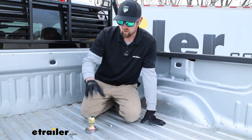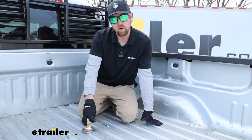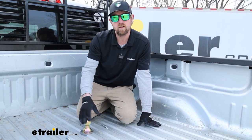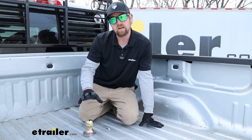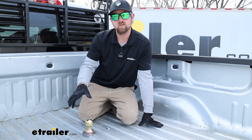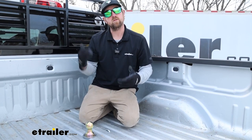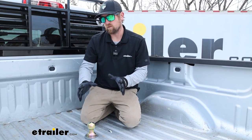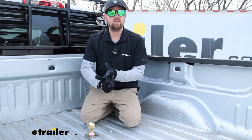For the most part, just about all the hitches are going to have a 30,000-pound maximum gross trailer weight rating, which is the amount of weight pulling on the hitch — that is the weight of your trailer plus anything you might have in or on it. It's a good idea to check the instructions for your kit and your particular truck to verify that weight capacity. And while you're at it, grab your truck's owner's manual too and make sure it can even handle that amount of weight. You never want to exceed what the truck or the hitch is rated to pull.